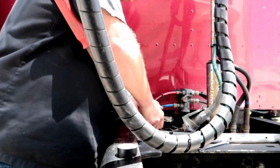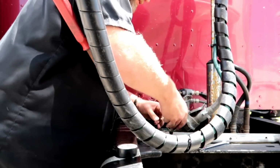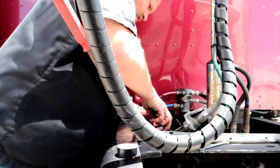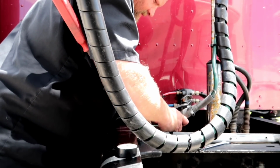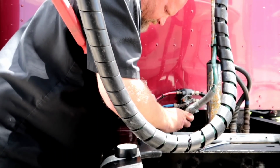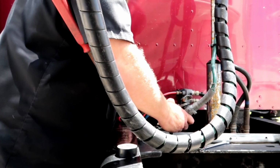Right now, guys, we are 100 miles into our day. We needed fuel. Pulled in here to get fuel, and I kept hearing the breaker pop every time I use the brakes. And when that breaker pops, it takes your blinkers out too. So that's what we're doing. We are trying to fix this right now. You know, it's your typical, when you open up one issue, it just kind of spreads on to another issue. Because I had them fix some wires up around the brake light switch up behind the dash when they had the truck.